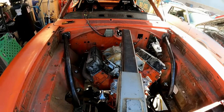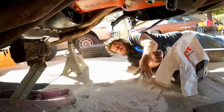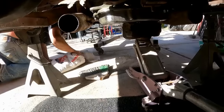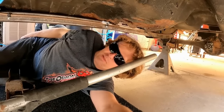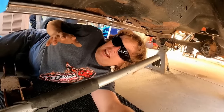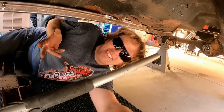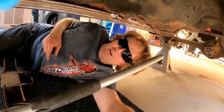Is it doing that? No, you just waste all that oil, all that fresh oil. So yeah, there is still an issue with the rear seal. The engine at that 45 degree angle filled up the bell housing, so when we leveled it out, it all just poured out. I can't believe how bad that rear seal is. I guess there really is something wrong with this block. Maybe it's cracked. It's something, because that's a totally different seal cap and it's a new seal top and bottom. And that leaked really bad. But I am actually glad that by the time this episode airs, we'll already have been done racing. So you guys won't know that it's a leaky piece of crap before we go racing.